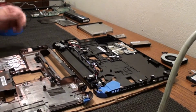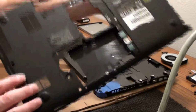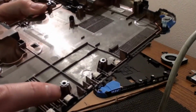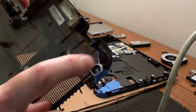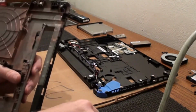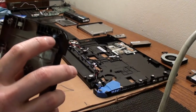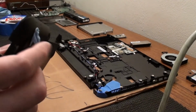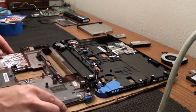Alright, so it's been a little bit. I think I'm ready to apply some epoxy in some areas. This is the back cover. Both sides had the little stands, these little stands right here. Both of them were broke off. So this one here, I made a little cardboard cutout and put it around there, and I'm just going to fill that whole area in with epoxy. And the other side, I still have a big chunk of the part that broke off, so I'm just going to set it on there, put some epoxy on there, set it on there, and then cover it with epoxy and see if I can use that same part. And I just got some tissue paper, paper towel or something stuck in the hole in both of these, so I don't fill the hole completely up with the stuff.